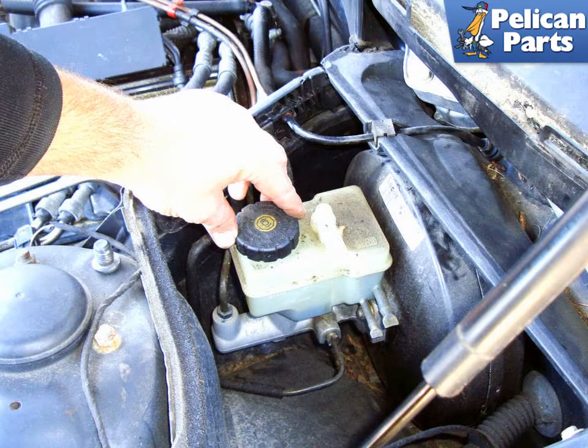This photo illustrates the brake fluid reservoir under the hood on the left side back by the windshield. Remove the reservoir cap — you have to remove the cabin micro-filter housing to access it. Make sure you clean carefully around the cap before you open it. You do not want to get any dirt, contaminants, or anything into your brake system.